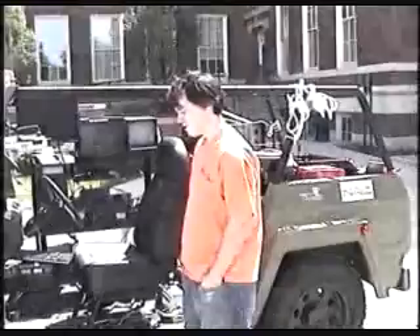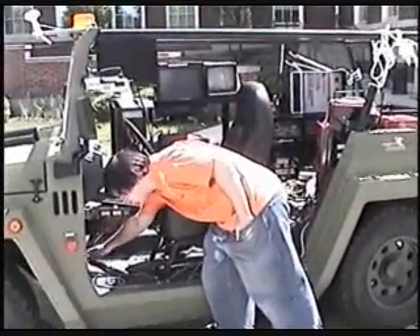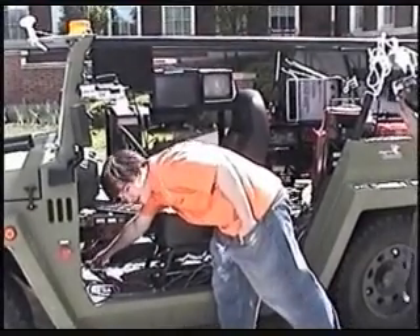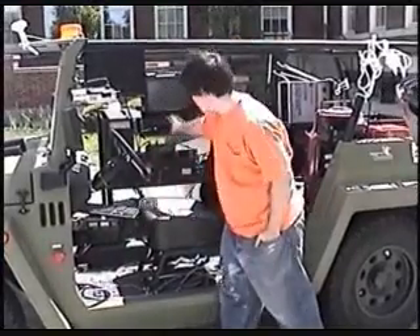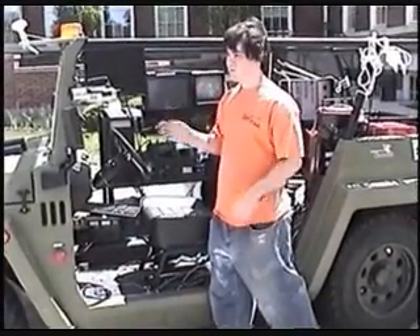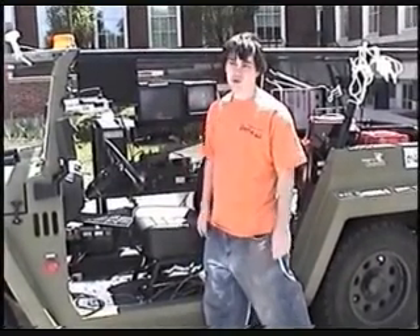I'm Jacob Watchman, and I'm going to talk about the speed control. For manual operation, speed is controlled from the pedal. We unhook the pedal and use this board to make four levels of speed control. With the computers, we can type in — using the parallel port — different levels of speed control and make it go at four discrete levels.